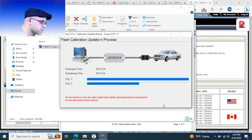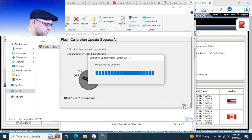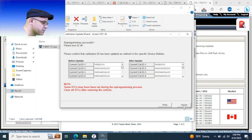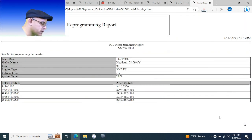That was one fast flash — the quickest six minutes I've ever seen. That is what Toyota does — kind of crazy, but it lets you know from across the shop that you're done. So you turn the key off, let it power down, and it's going to read it again and confirm successful. Then here's the programming report — you can print that out and give it to your customer.